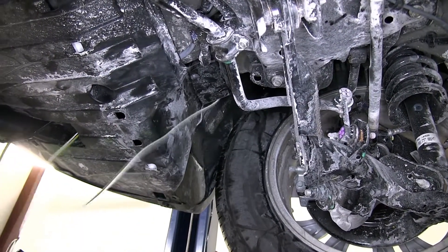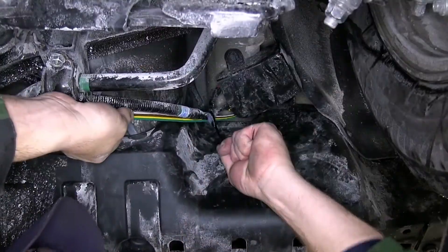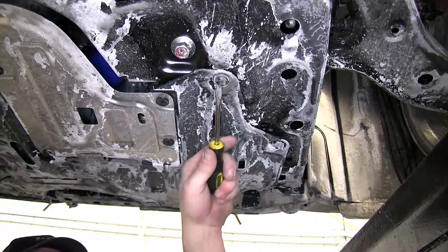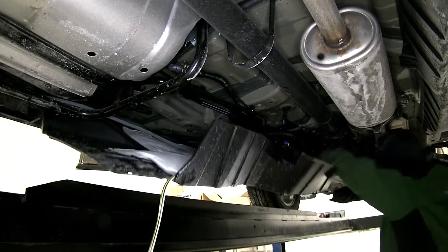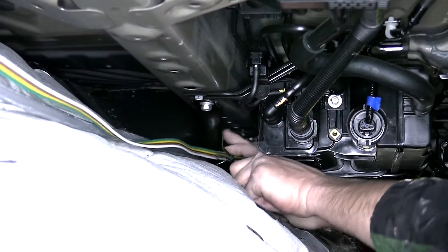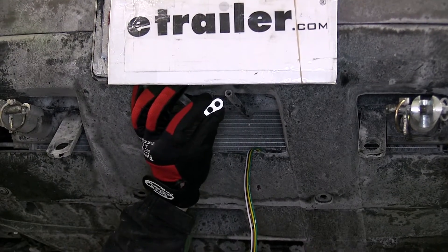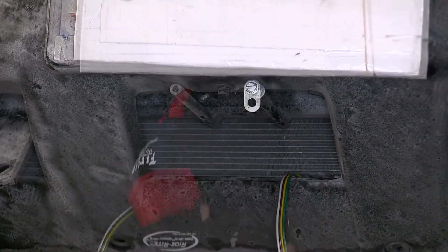Keep in mind when routing your wires: stay away from any moving components such as steering or suspension, or excessive heat sources such as the exhaust. As we route the wire, we'll also secure it with zip ties as necessary. For this application, it may also be necessary to loosen or remove some of the underbody panels when routing your wire. With the wire routed and secured, we'll mount it to the base plate. Using the hardware provided with the base plate, we'll secure the mount with the self-tapping screw directly to the base plate electrical mount, then route the four pole to it and secure it with a zip tie.